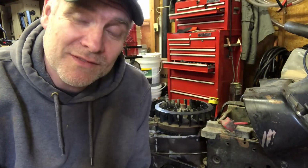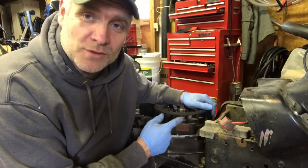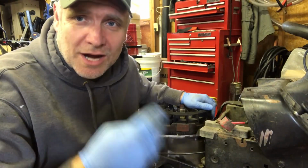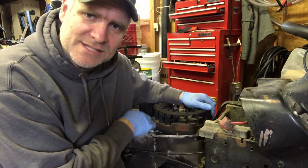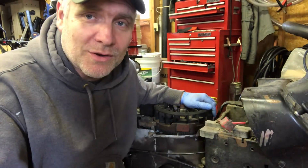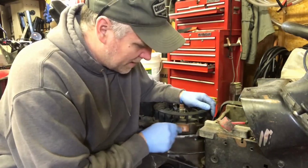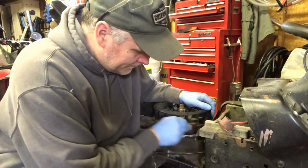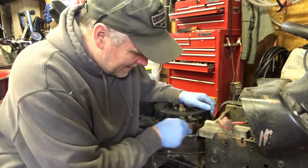We're gonna chill out here for a little bit and let everything settle. Another reason why one of these engines won't start very good or not at all, there is a magnet on here, and the rustier the magnet gets, it's harder and harder for it to send the magnetism by these coils, and these coils set off your spark plugs. So if they're too rusty, you won't have any spark either. So while we're in here, we're going to sand the magnet down to bare metal.